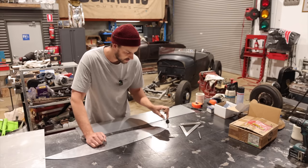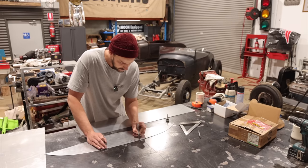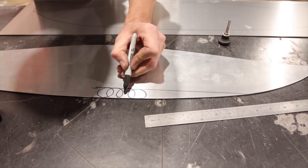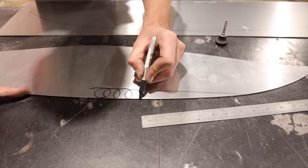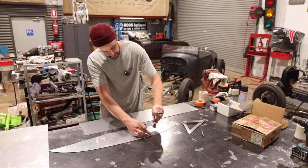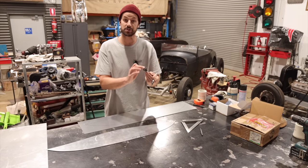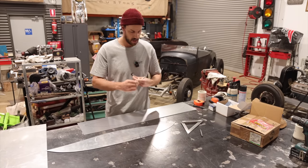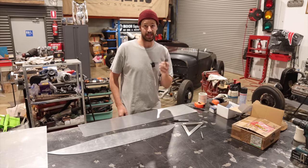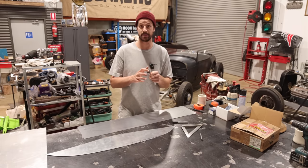You don't want to run that, otherwise you're going to have a weird pattern. If you were to draw a straight line, then this one's going to have your 50% overlap, like that, and then it's slowly going to go off the edge. But if we were doing this over there, this thing is spinning on this edge, which makes it really tricky in order to get a nice finish. And it also burns this out really fast. So you want to try and have a flat surface as much as possible. A little bit of lubrication helps and keeps the aluminum from wanting to gum up inside here.